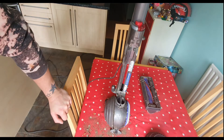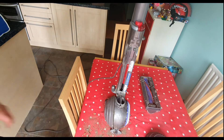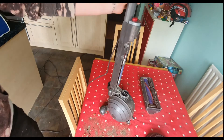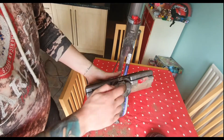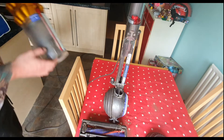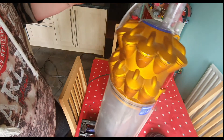I ended up doing a little DIY fix and just put some superglue around the end of it and glued it back on because it wouldn't stay — the rubber had stretched. But it worked fine, and it must have been like that for a year or more with no problems. Really that's all it is to these hoovers. If the motor goes you're out of luck — get a new one. But filters are easy, blockages are easy, rollers are easy. Make sure your seals are clean so they're making a good seal — that'll help the suction.